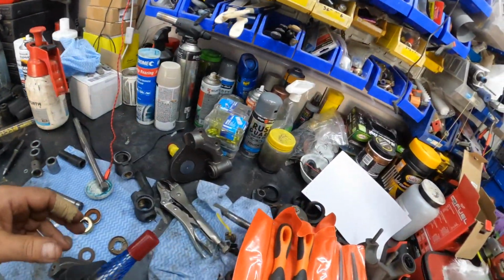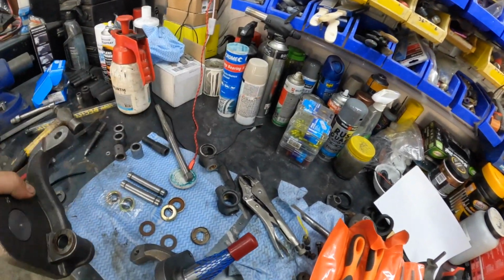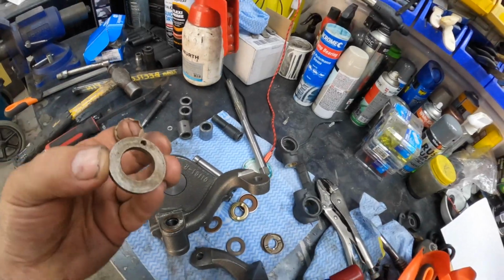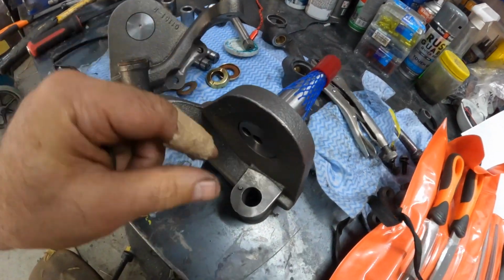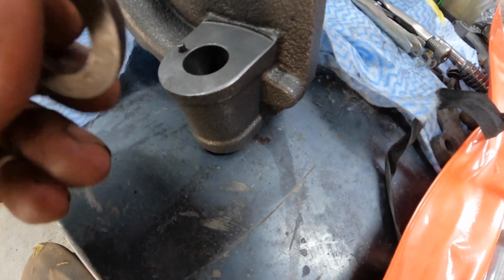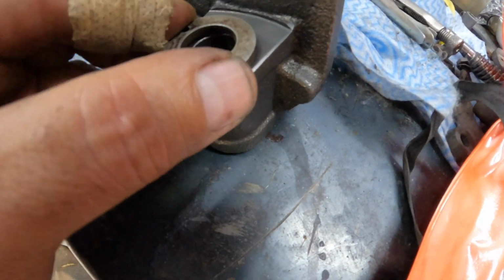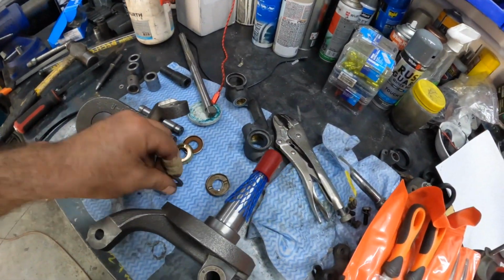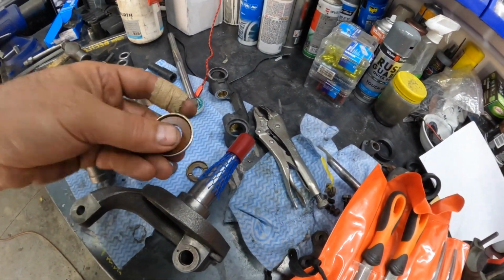We do have our 2-inch drop spindles here, and we also have the little washer which has the pin in it, and that goes into its little location right there. There's a little pin, and you basically plop that on top like so and give it a little tappy with a hammer. Tap that in. And then we've got obviously our fiber washers. We have the new ones.